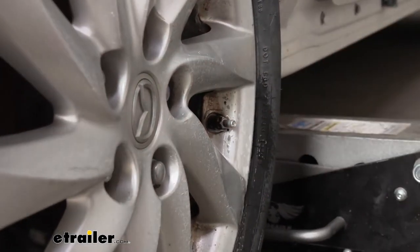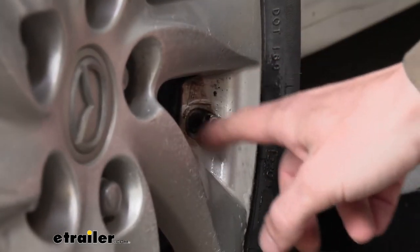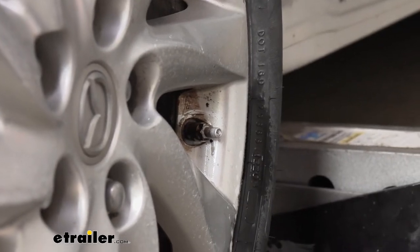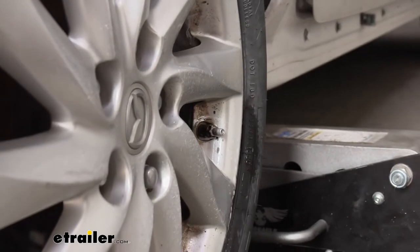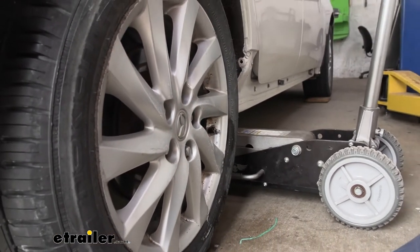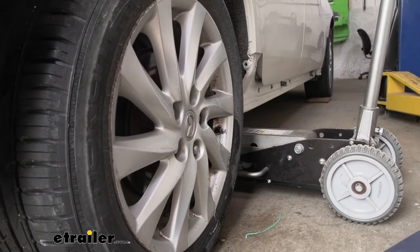If it's leaking out of the core in the middle, we can probably repair that with our kit. But if it's leaking on the outside of the valve stem, the tire has to be removed. If there is a leak around the outside of the stem, you're probably going to have to go get service repair done at a shop, because on this vehicle it's a tire pressure sensor — a regular valve stem would hold air in the tire, but you'd have a warning light on and no longer get tire pressure reporting. It's also very difficult to install a valve stem at home because the tire has to be removed and the bead broken.